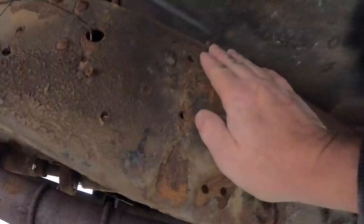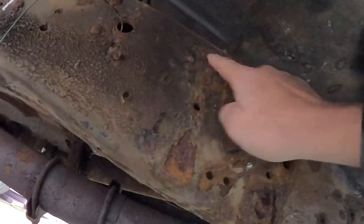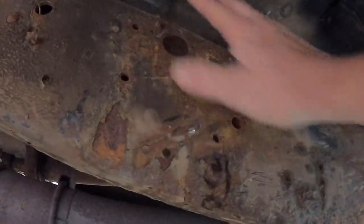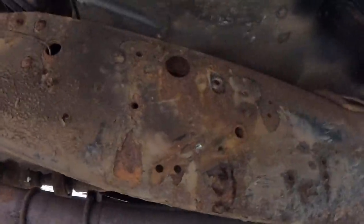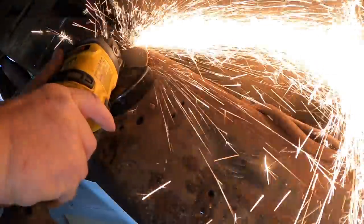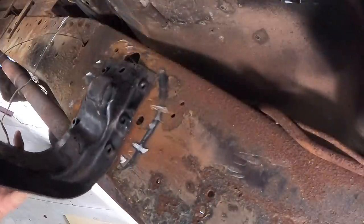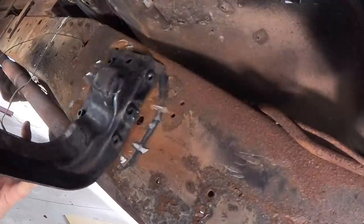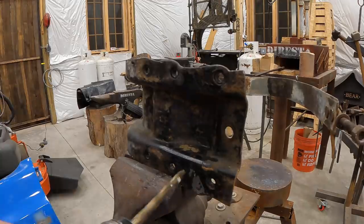But for some reason, there's these bolts that come through the frame. They don't hold anything. They're bottomed out on the other side of the C-channel and they're sticking through here. So I'm going to cut those off to give me a clear space here to start matching up these holes through the forward bracket. I'll get less comments if I drill this versus drilling the frame.